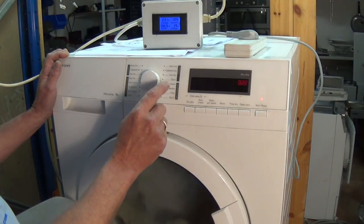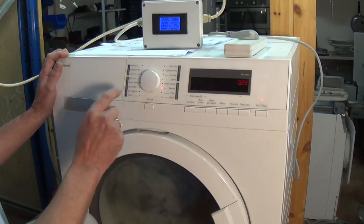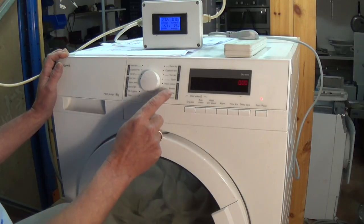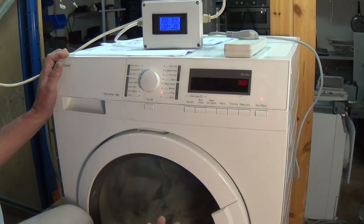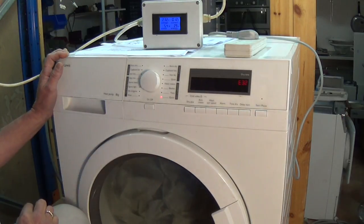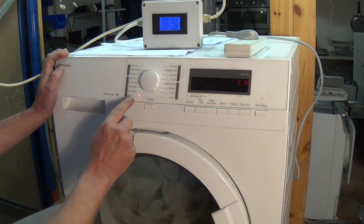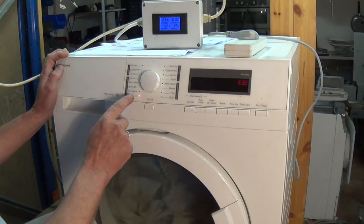C7 — I don't know exactly what it is but I believe it relates to Quick and Wool settings on this machine. C8 holds the previous error code — in this case error code 32. I'm going to publish all the error codes for these heat pump dryers on the website, so just follow the links above or in the description below. C9 also holds an error code; I believe one of these may clear the error code once selected, but I'm not too sure on the process.